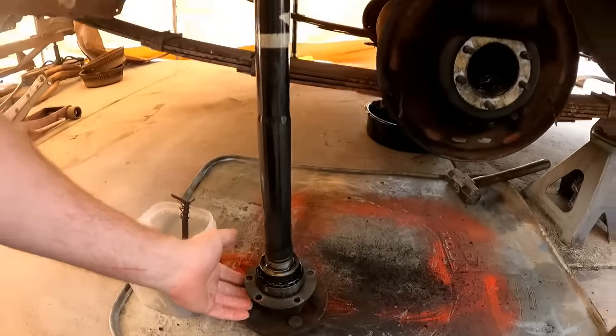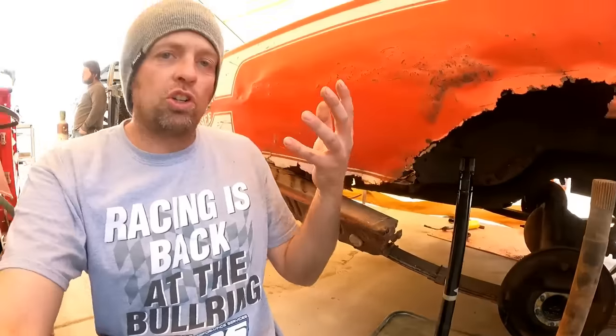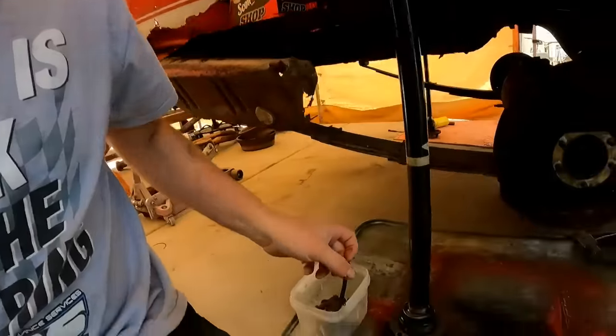Can you tell I just don't like these things? Now, the only bad thing really with the original roller bearings, and it's not even really a bad thing, is there's a spacer inside the differential that pushes on each axle. Without that spacer, you wouldn't be able to adjust the preload on the taper bearing, just like front hubs. It has two taper bearings in there, and it has that nut that you adjust to adjust the preload on the bearings. Well, there's also a preloader on the axle, which is it on this one?